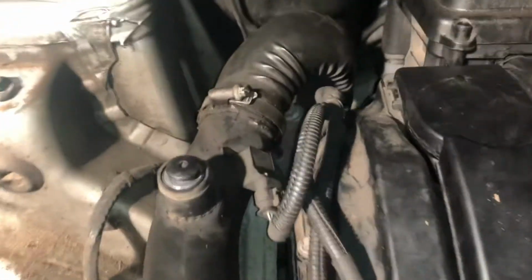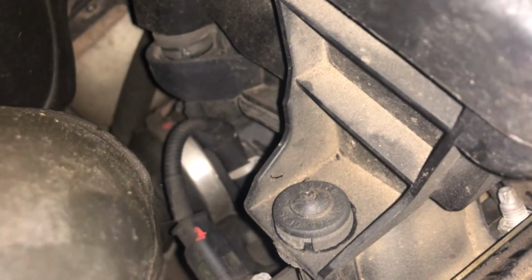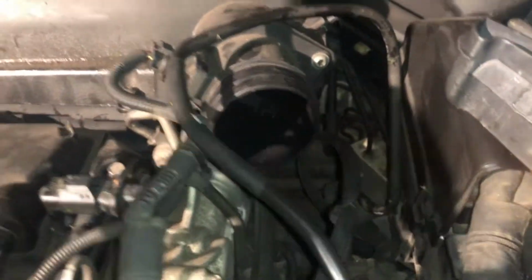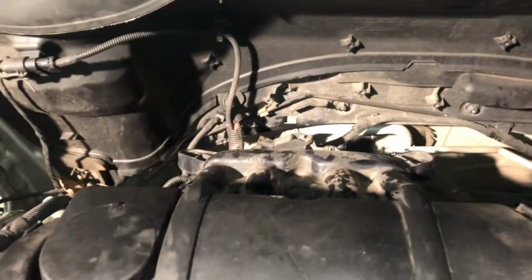I'm going to take the intake manifold off next. So I've loosened up this pipe over here, this bracket. I'm just going to take these Torx. I think that's a T25 Torx, I'm guessing. There's a lot of plugs and things around there, so I'll take this plug off. I've taken this line off already. So the airbox came off with that. I think it was a T25.